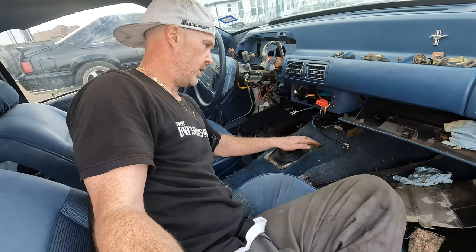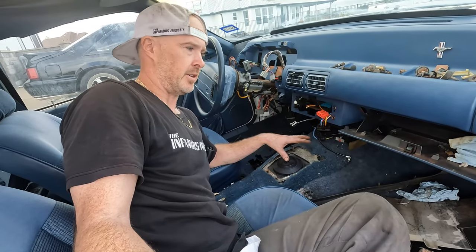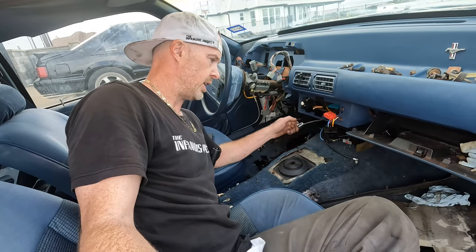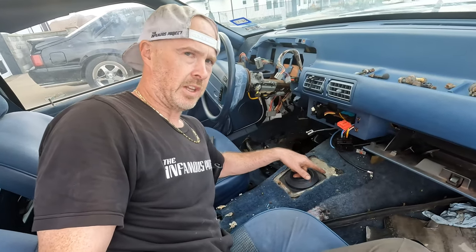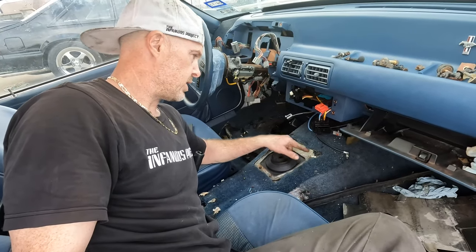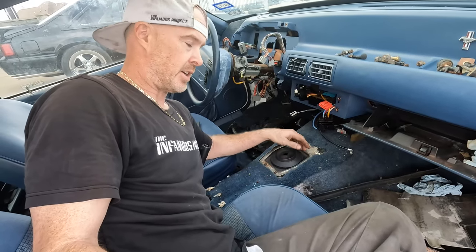So there you have it. Now, like I said, ultimately you want to cut that out when the transmission isn't in the car. So use this as your template, as your guide plate. I just wanted to show you guys firsthand, because there's always that, oh, I didn't need to trim anything or do anything. And I feel like a lot of people don't try and install factory hardware, these clips for these little 5/16 bolts. I feel like I've seen it a lot of times.